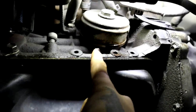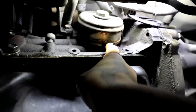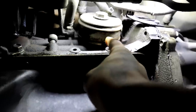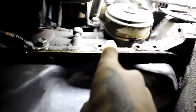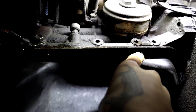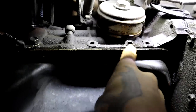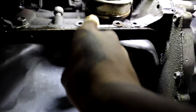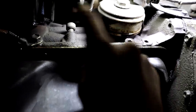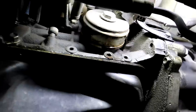This is the leak I'll be tackling today — this is the engine oil cooler, and you can see it is leaking right there. Similar to how the oil filter leaks, the oil tends to stick in this little lip in between the block and the oil pan and seep across, which can make you think you have an engine oil pan seep when you don't.